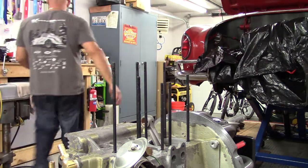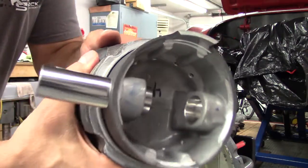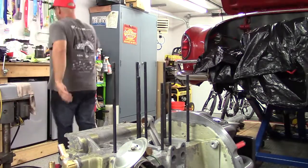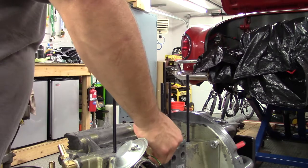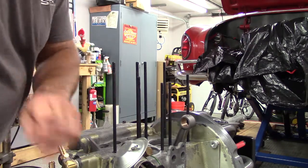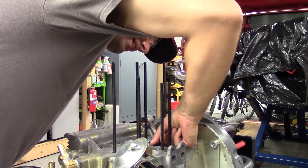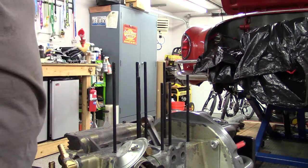We're going to have to clean up the base of those jugs. Around this gasket sealing surface there's a little bit of gray Permatex — I'm going to need to pull that off. Luckily it's rubbery and it just peels right off. I use Permatex Gray. There's a million different sealants and a million different schools of thought — you don't need to use one, there are different ways to do it. Websites like the Samba preach a ton of information, and nine times out of ten you can get yourself drunk reading it because it's confusing and there's an awful lot. Once I get this cleaned up, we'll take a look again and reseal these with the barrel shims.